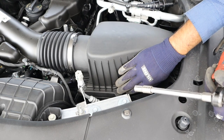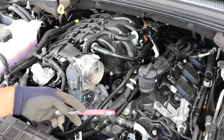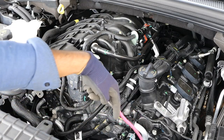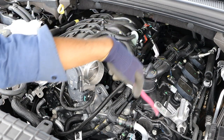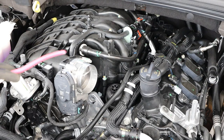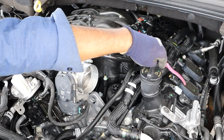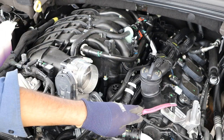I wish they actually used snap clips so you can do this without tools. And here's the air filter. With the air intake out of the way you can clearly see two banks of cylinders — one with three cylinders on this side and one with three cylinders under the intake plenum. That's where we come to the spark plugs; there's three ignition coils right on top over here that make it easy to change the spark plugs on the driver's side.